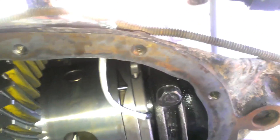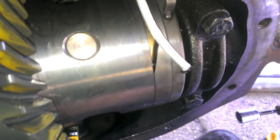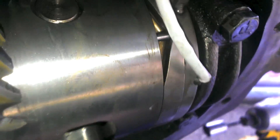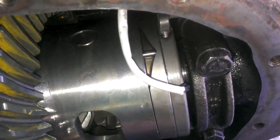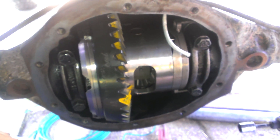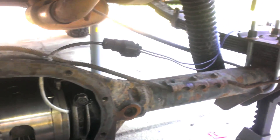When you flip the switch you'll see a faint red glow on the switch indicator — my battery is low so it's dim, but it'll be bright in the cab when fully installed. Red glow means the locker is activated and current is flowing. Over at the axle, the pin will still be sticking out — just rotate the pinion by hand and you'll see it ride down the ramp and lock. In reverse it unengages and locks on the other side of the ramp. When you flip the switch off, the pin just floats. That's a properly functioning e-locker — now put the cover on, fill it with fluid, and finish wiring it up.